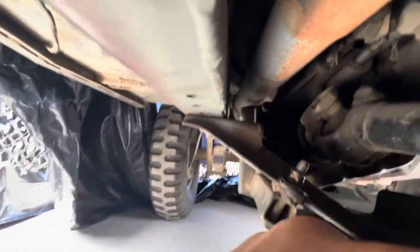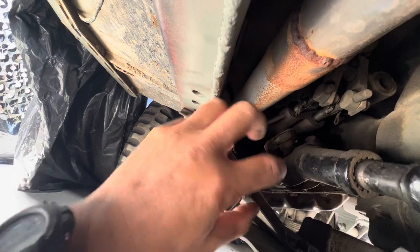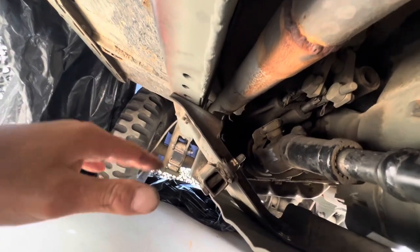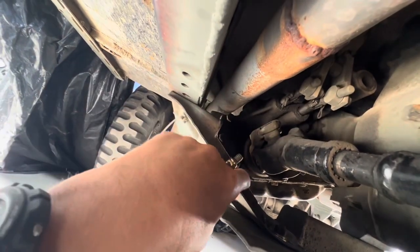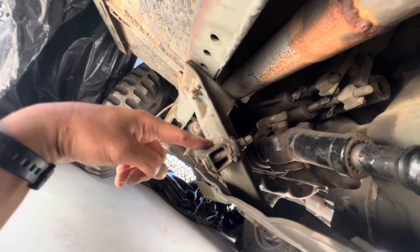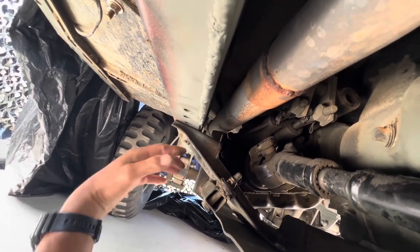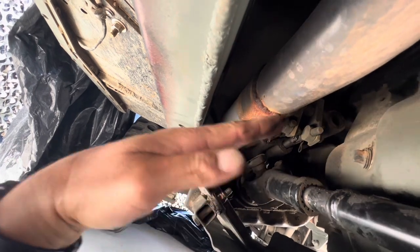Here's Slum Dog — you can see the notch right there. The driveshaft moves and you've got like less than an eighth of an inch clearance — maybe a sixteenth. It clears on flat highway or rock, but once you incline the front of the vehicle, this will flex and it flexes down into the cross member and it barely starts to hit it. If you don't have the bracket — that's the Mike Picard special right there. We put rubber washers in here so it has flex but it's also in there pretty good. Two bolts that way and two bolts on the transfer case keep it from doing the twist.